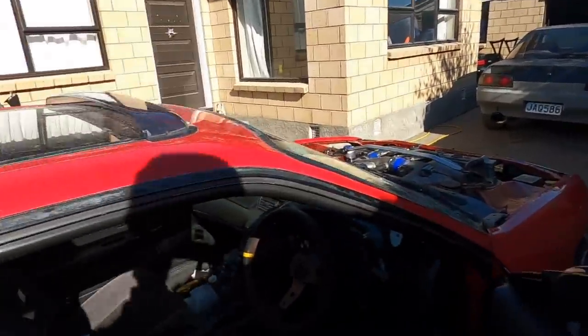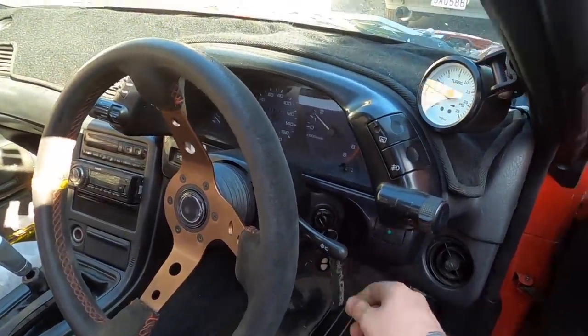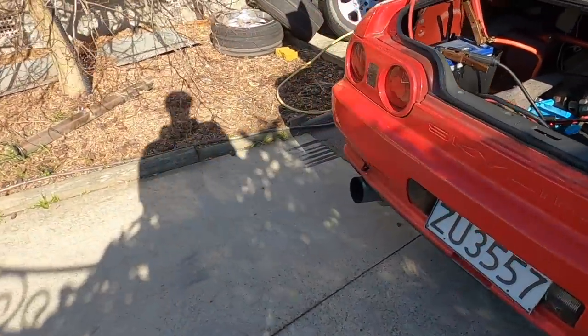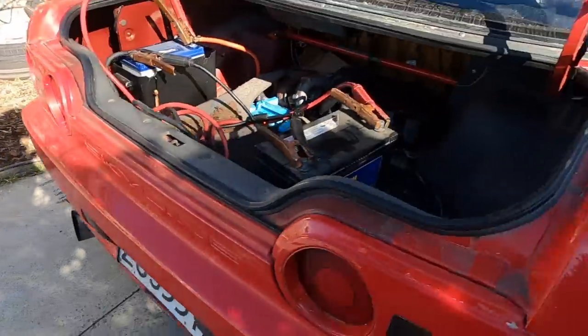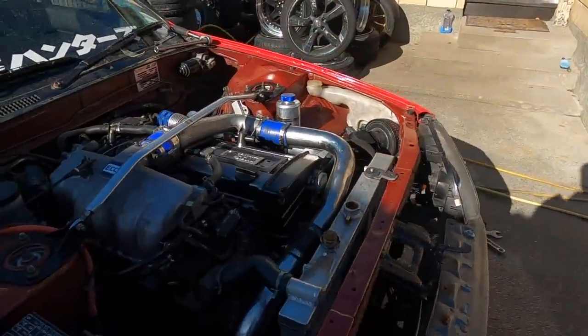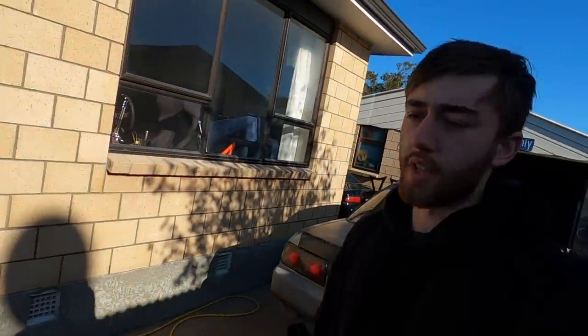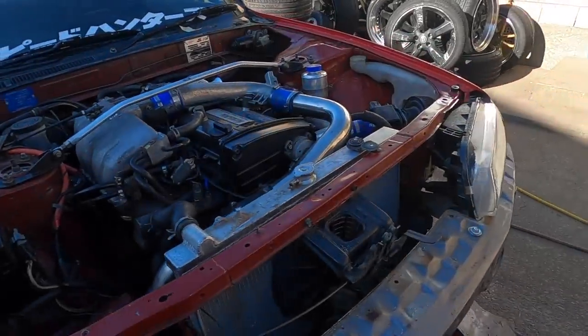Tighten that up, take two, but this thing fired up right away. So I've run Ryan's R32 up, got it up to temperature, and then turned it off. Now I'm going to drop the oil out and put some fresh stuff in, and I'm also going to get a new filter to chuck on there, and then this just needs some running Ks.